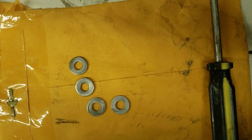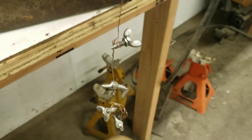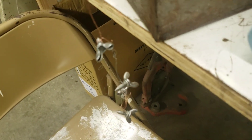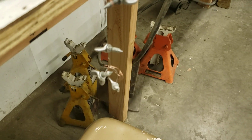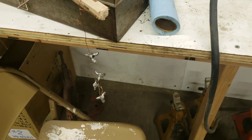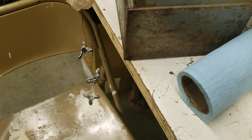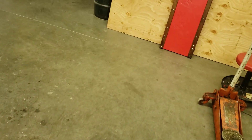You can buff them up and make them shine a little more if you want. There they are drying. A quick coat of clear poly buys you several more years of life. If you look at World War II photos of Jeeps in the Pacific, hardware like this with just a zinc coating and no paint rusted up within a couple of years. But the little poly coating - you can't tell - and it makes them hold up a lot better for a long time.